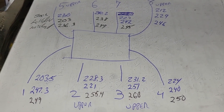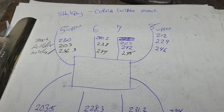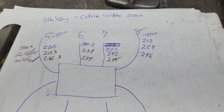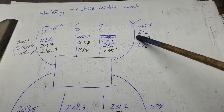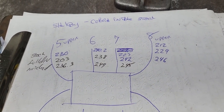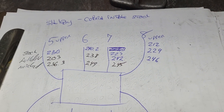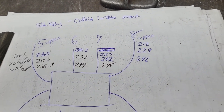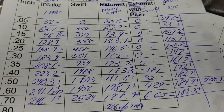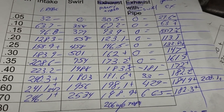Not great. Is it possible to get more out of this? Yeah. Will I work on it? Probably a little bit more, but not a lot — this has already got a ton of time into it. The next part of the equation is the heads are flowing about this much. So when we bolt it on with the carb, the intake, and the head, we should be doing better than we were last time. Our last time we flowed through the carb, the manifold, and the head, we did 198. Now if we have the head flowing about 245 and the intake manifold flowing 245, we should be able to beat that. Then we'll do some calculations and see what else we need to do from that point on.